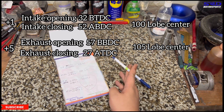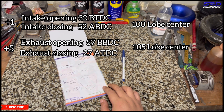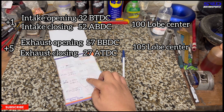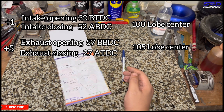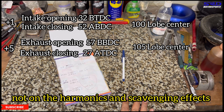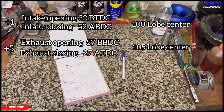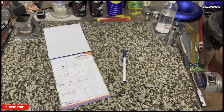That's it — 100 lobe center on the intake and 105 on the exhaust, exactly matching the B-series cam specification. Some people say on the dyno you make more power by advancing further — but that's not because the cam degree is wrong. If advancing the exhaust makes more power, it means you're relying on the mechanical piston movement to push out exhaust, which means your exhaust system isn't efficient. Your builder needs to know this. That's where all the real development knowledge is — why on a second tune we always make more power.